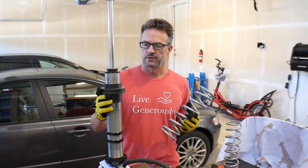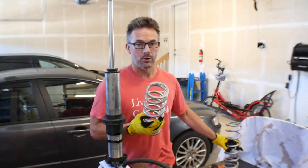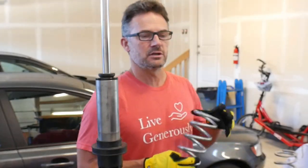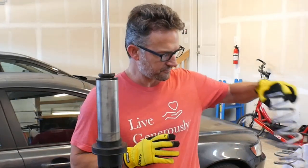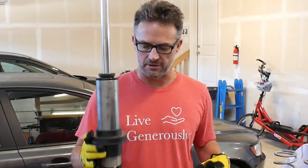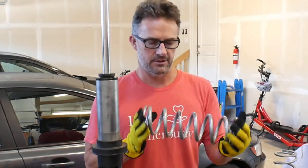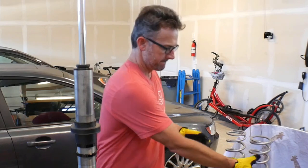You have to set the slider so that it stops before it crushes the 150. Personally I don't like to run my springs that far apart — I run them close; mine are a 150 and a 200. But even so, I want the full effect of the 200 since I have it. To do that you need to set up your slider. You can go to the Eibach website and look up your springs to find the data you need — like for my 12-inch 200-pound spring.